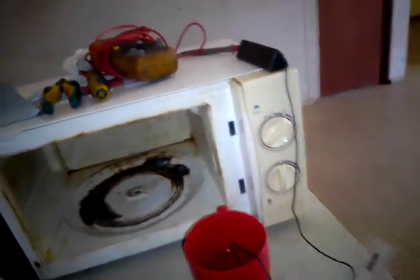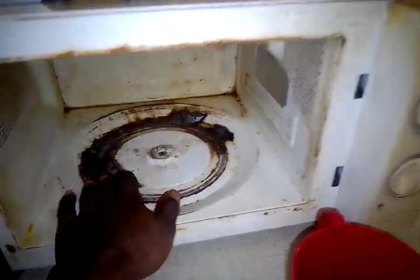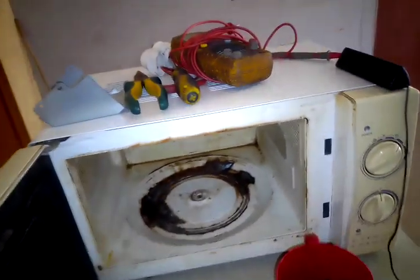Don't be afraid when you see fire inside your microwave. First check the waveguide, but also check the cavity interior — a damaged or peeling cavity can also cause fire. I've seen many microwaves where the cavity is broken like this, which is dangerous. If the cavity is damaged, you may need to buy a new microwave. Now let's open it up, but first unplug it from power.